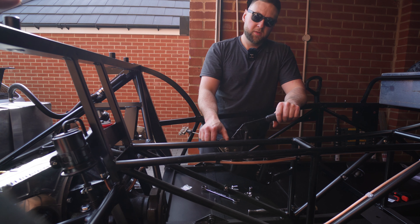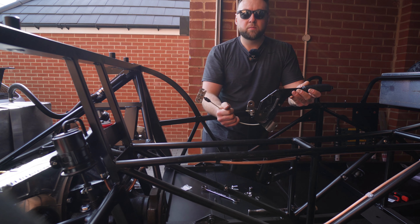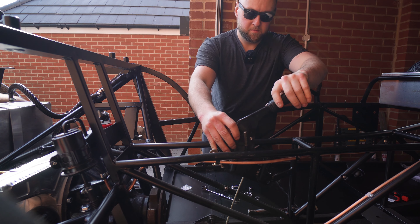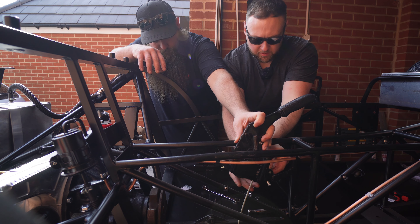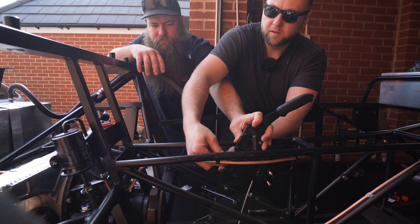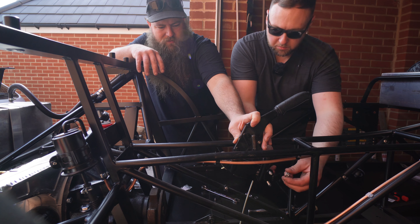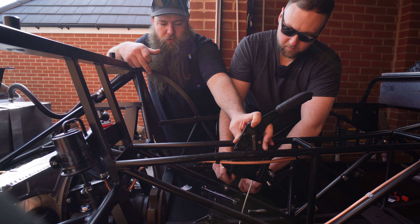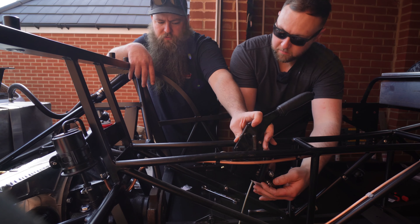We need a handbrake. So this is the Mazda MX-5 handbrake removed from the Mazda that we've had. We've taken some bits off - you follow the manual. You have to do some stuff with the brake switch and take the spring off. So this is just three bolts. Make sure they all line up first. Look, we'll have this job done in 10 minutes. These are all supplied in a kit - 8mm domed head Allen key with a little nylock and some washers.